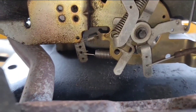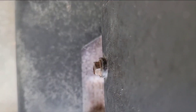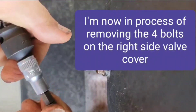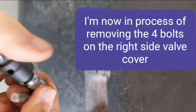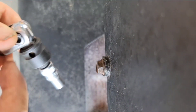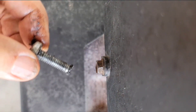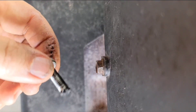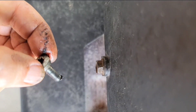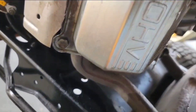While I'm down in here I'm gonna put some silicone grease on these moving parts. I'm using a T30 with a quarter inch drive socket and an adapter to go to three-eighths. These are coming out easy — spraying them down with some WD-40. This one's really greasy, so this has definitely been leaking. I got three of them out now.